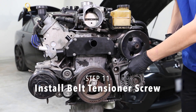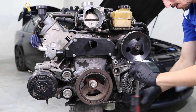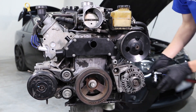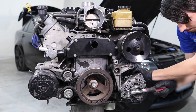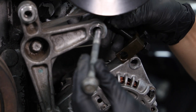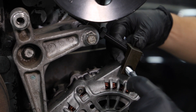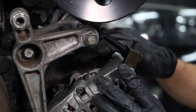Step 11. Install the new belt tensioner screw. First, remove the top alternator bolt and retain. Remove the mounting bolt at the rear of the alternator if applicable. With these bolts removed, loosen the lower mounting bolt to allow the alternator to move. In most cases, the alternator will not fall out of place. When this is the case, you will need to rotate the alternator out of the way so you can install the new tensioner. Assemble the screw tensioner and install into the top hole of the alternator using the retained bolt. Using the supplied bolt, install the L-block onto the alternator. Place the flat and spring washer on the bolt and then tighten the nut. Do not tighten the nut all the way just yet, as we will need to set the position of the L-block first.